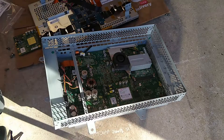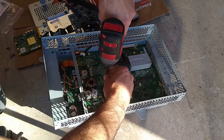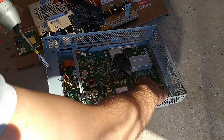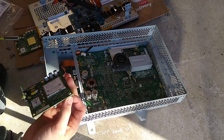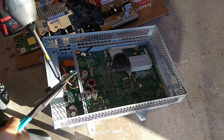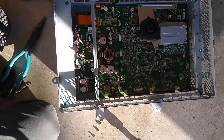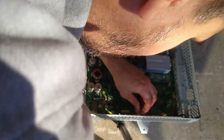Let's keep them in order. These are T10s, so we're gonna take out the four screws. There's some reason this one didn't lift up — there's a screw on the bottom of it, that makes sense. So this is the old one out. There's a plug right here, so this one's got to go straight down and plug in.